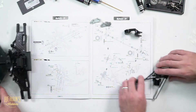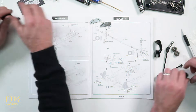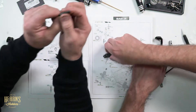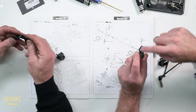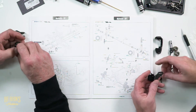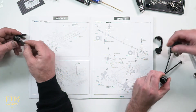Alright, so what are we doing? We can get the car out of the way for the moment. We're going to assemble the caster blocks - the front steering blocks. I'm going to do left, you can do right. So how do you know which is left and right on these? They're clearly marked - they're angled and the dots are on one side. They've got these little five dots on one side. What's the five dots for? So there's five increments of these Ackermann plates - it indicates the actual Ackermann. The kit setup for these is five dots, which is the most Ackermann.